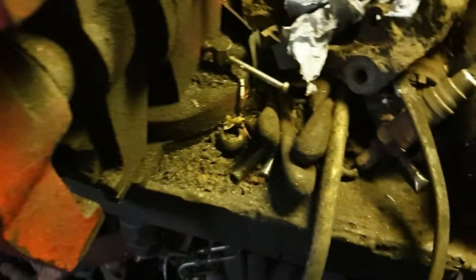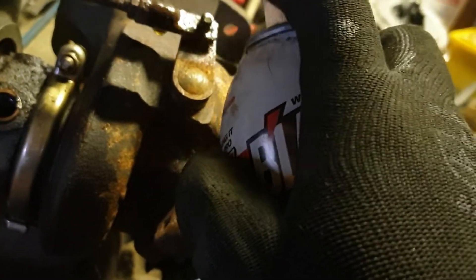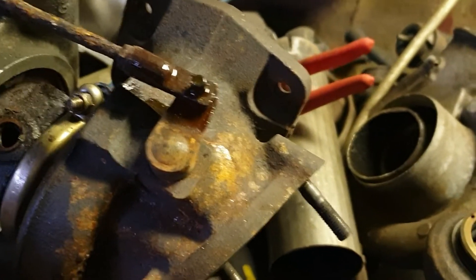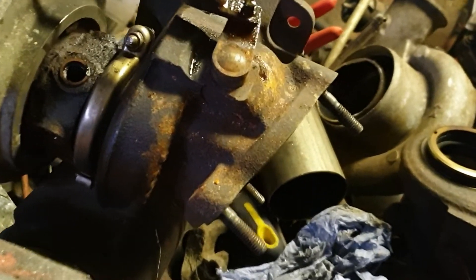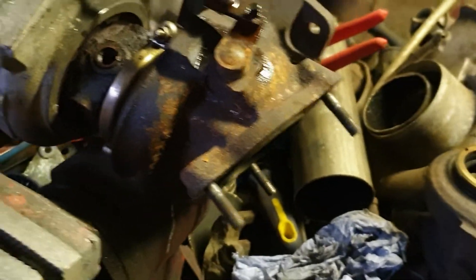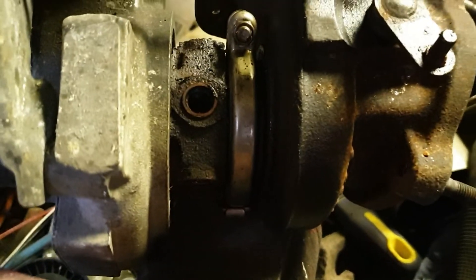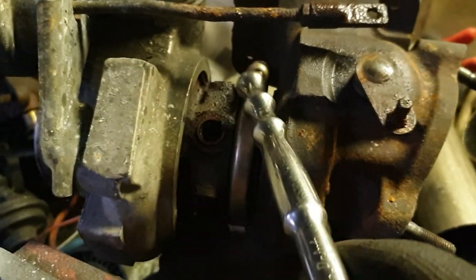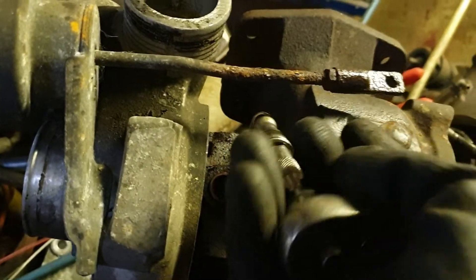It'll be a bit cleaner, but for the purpose of this, clean up and spray plenty of your favourite penetrating fluid or oil — whatever you want — on it and let it soak for a while. Come back to that in a bit. To break it down to CHRA, we need to split the hot side off before we can get the cold side off. Make sure you have plenty of fluid on it and just take the band off.